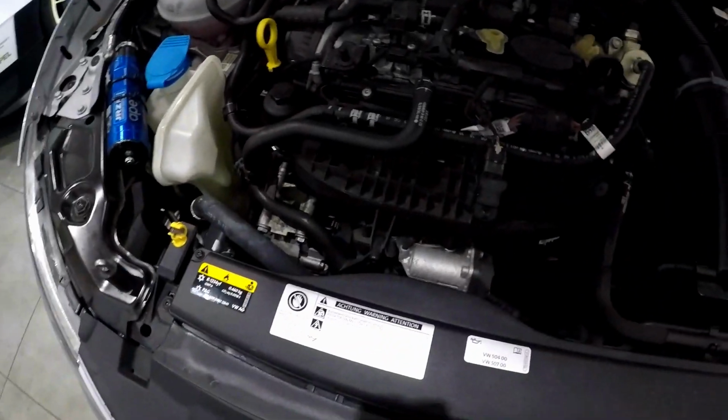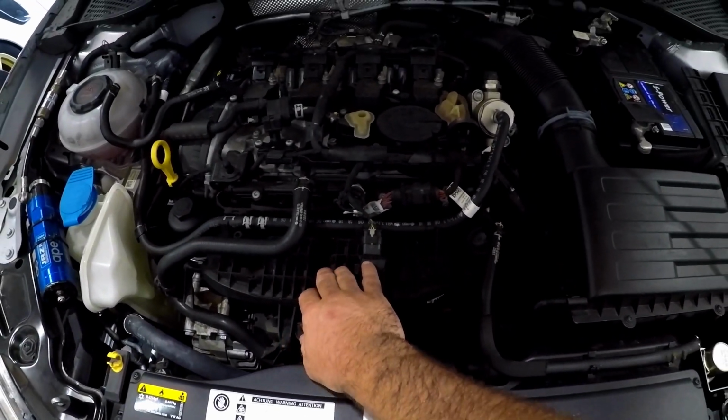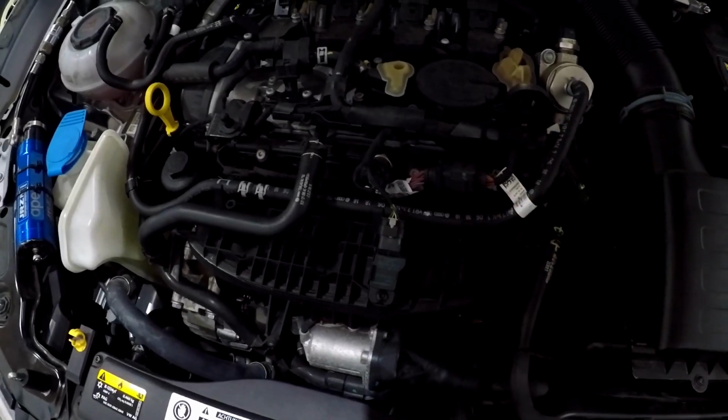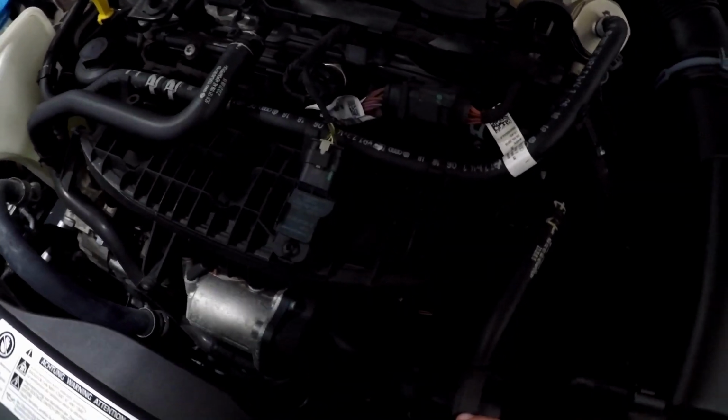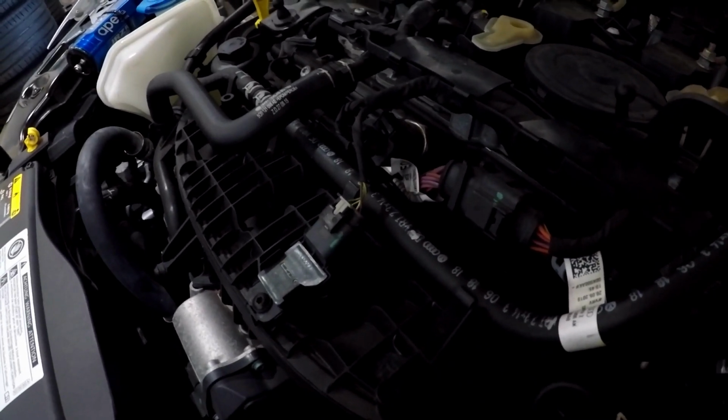Now, a catch tank is basically a filter. It works the same as a filter. So you have all the gunk and all the crap that gets blown out of the engine and essentially goes straight into the intake manifold. It blows out, goes into the intake, and then coats the intake full of crap, basically. All the nasty gunk, and there's no real way to put it other than crap, to be honest, which then blows in, gets stuck on the valves, creates carbon on the valves, essentially giving you running issues.